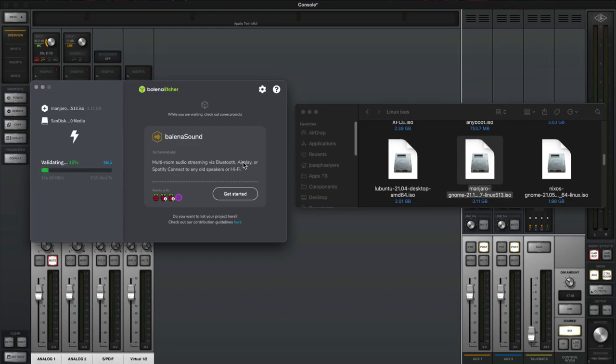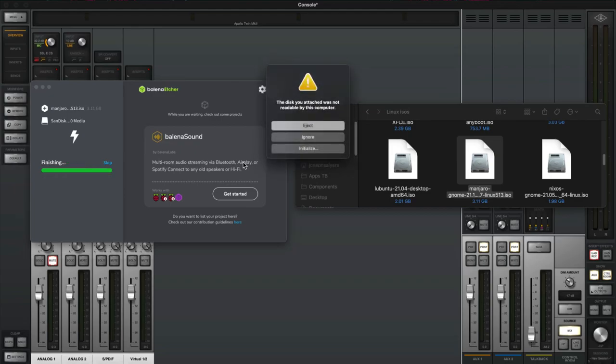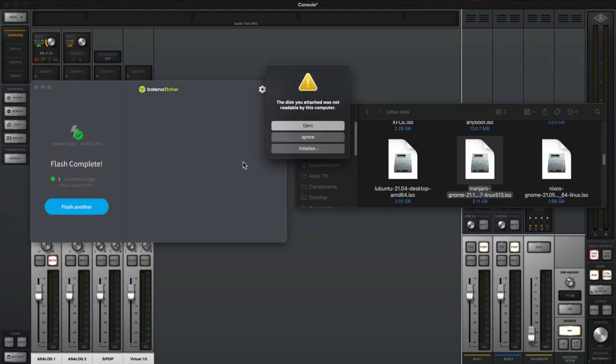Now we're going to move over from the Mac to this HP with an i3 7100 in it with 16 gigs of RAM. I tried to put as much RAM as I could in the machine. It's only got two slots, so I stuck two 8 gig sticks of DDR4 at 2666 in it. And I had a 500 gig SATA SSD that I just stuck in it. The machine was just an empty machine. It used to record our security cameras at the studio, and it didn't have anything in it. So I thought, well, this would be perfect to show how to set up a Linux for Pro Audio machine.